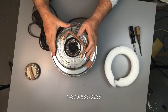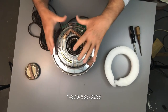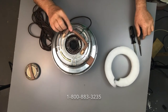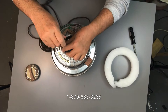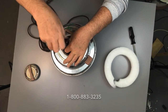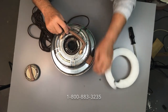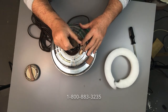Now they look like they're in a triangle but they're not an exact distance apart from each other, so you have to be careful and pay attention to how you're going to put it back together. These are regular screws — the newer versions all have Phillips head screws. So we're going to take out these three screws. These screws go into a plastic housing that houses the motor.